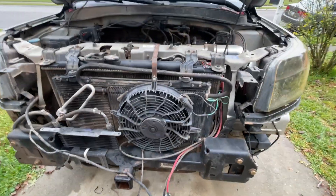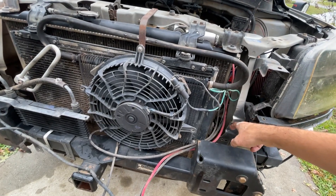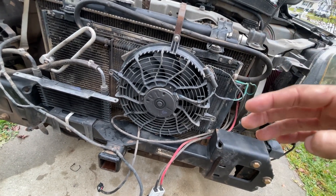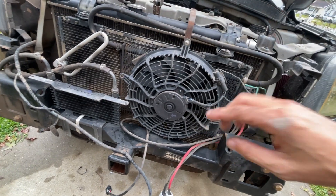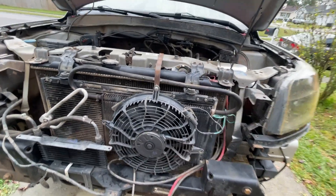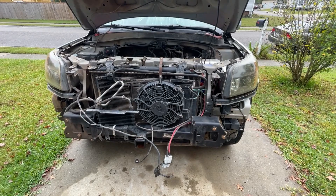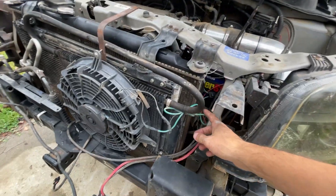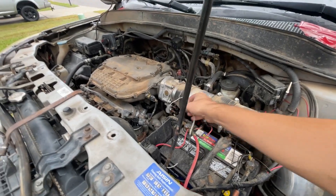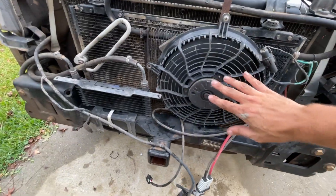So I'm going to replace it with an actual Hayden power steering cooler. This is my transmission cooler setup — transmission fluid comes from the transmission and I have it running through transmission coolers first to get it down as aggressively as possible, then it runs through the radiator. I didn't bypass that system so that on cooler days the radiator actually brings the temp back up a little before sending it back in, which is important — you don't want your transmission fluid too cool. It runs on a thermostat that kicks on at 180 degrees, and I can manually turn it on by moving the alligator clip onto the positive.